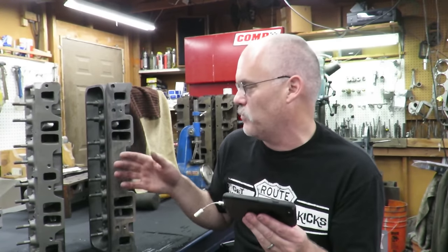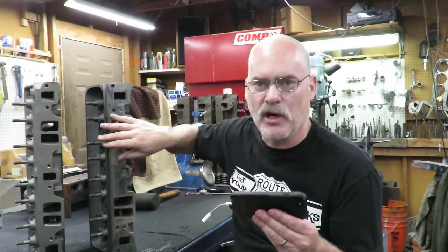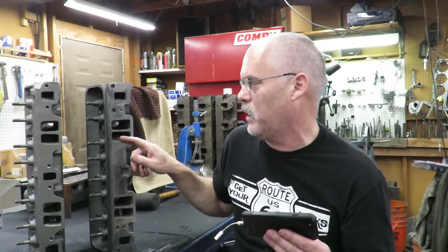Well, that's a far cry from the 390 lift cam and 198 degrees of actual duration that we had in here. So we're gonna put a much larger camshaft so we can get the air in and out. About 500 lift is where these flow really well, so the lift of our cam matches the flow of our Vortec heads.